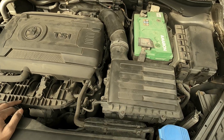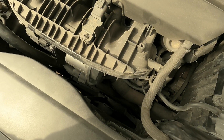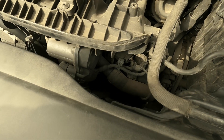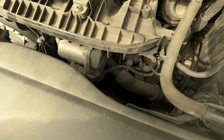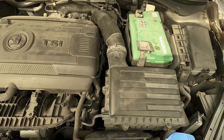What we are doing is disassembling the airbox first, then this connector, then the radiator fan shroud. The fan shroud comes out, then the throttle body, all the fittings and pipings of the intercooler and radiator up front — we'll create the space so that we can work. The very first thing is the airbox.